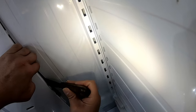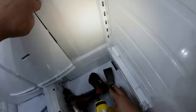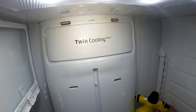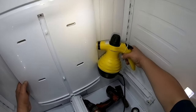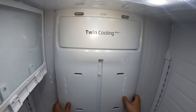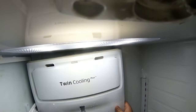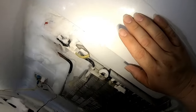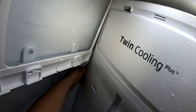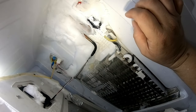We're going to get to the thermistor later in this video. As you can see, I'm using a putty knife after I put the steamer and the hair dryer on the panel, prying it out — it was very complicated. This was the most time-consuming part: defrosting just enough to remove the panel because the ice is still there. That ice should not be there — it's forming because the thermistor is not working properly. We're going to replace that thermistor with the yellow wire. Now I'm trying to disconnect the harness for the panel, and the fan motor is covered with ice.